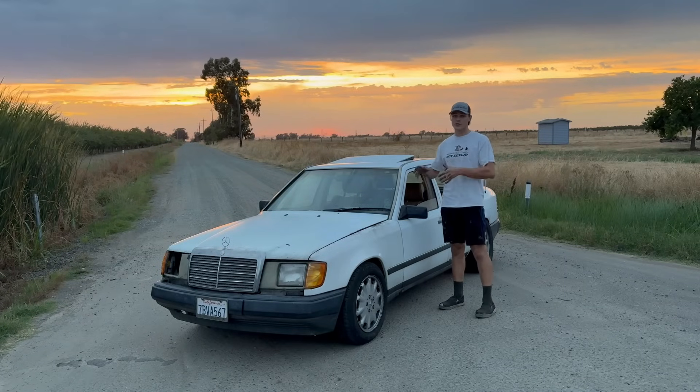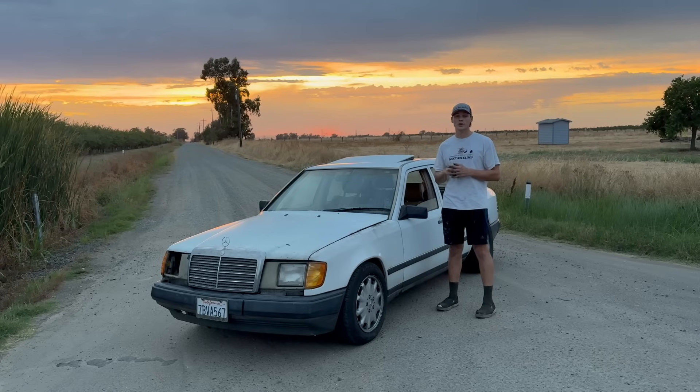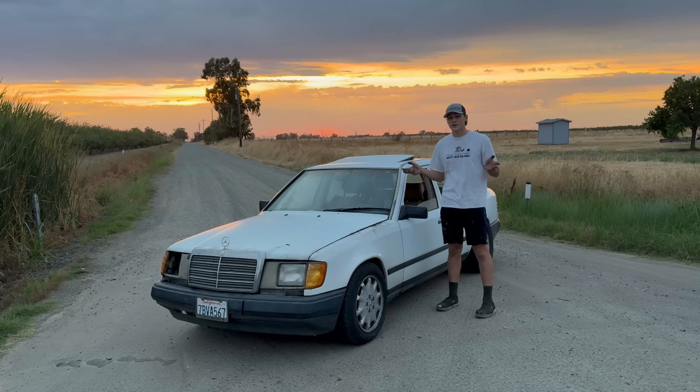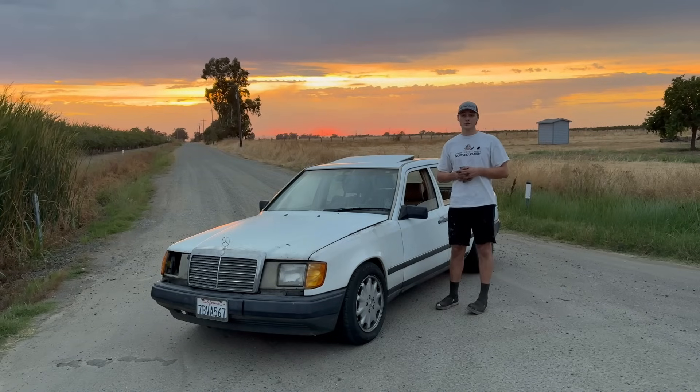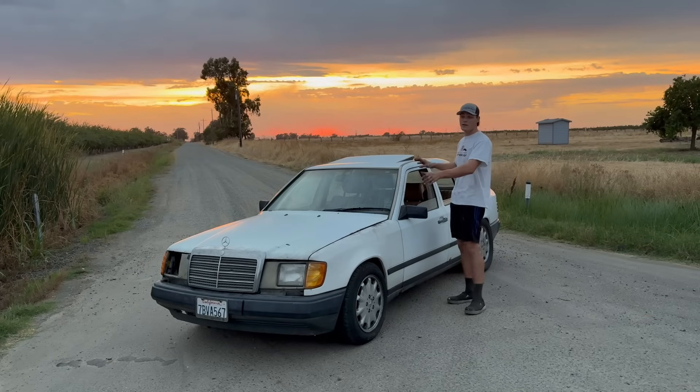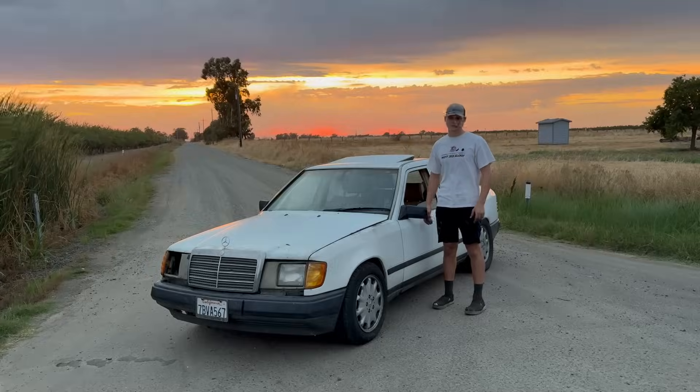In conclusion, we've gotten this car from an 11.40 zero to 60 down to a 4.59, which is pretty crazy. The HY35 spools very quick but it also makes very high EGTs - max was around 1400 EGT, which is really hot. Wouldn't recommend the HY35 if you're trying to push it to the max, but if you're looking for a streetable turbo that can still do decent power, the HY35 is not bad. The HE351 is similar but not the same - it spooled a little bit slower. Between these two, I'd choose the HY35. There are other options like Borg Warner and HX35, but this car went from extremely slow to a car that can keep up with AMGs. Thank you guys for watching, God bless, have a good night.